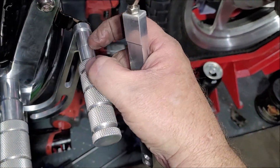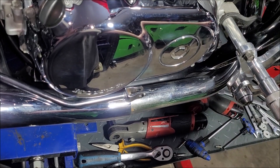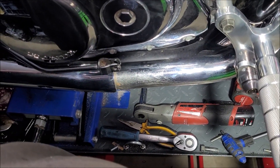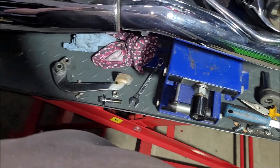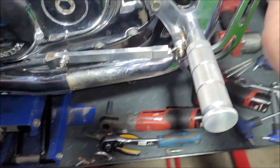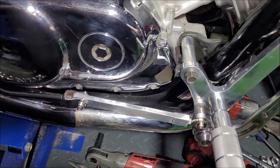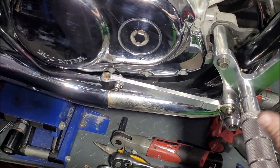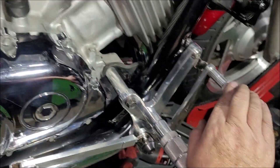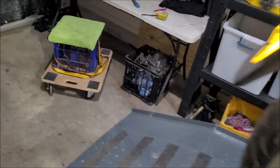I'm also going to take this spacer out so when I'm riding I can rest my foot next to the brake, not on the brake. I don't know why there's a spacer in there — maybe people like to rest their foot on the brake, I don't. I'll trial fit it again and come back. Alright, back again — I think we got it sorted. Still got to tighten that up and Loctite and finalize it. That way it doesn't come up any higher than it should. Wheel spins free, brake travel's good. I'll drop it down and sit on it and go from there.